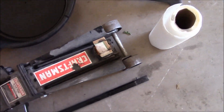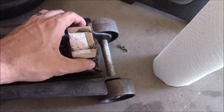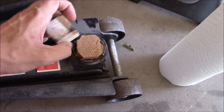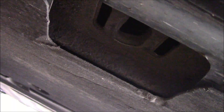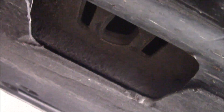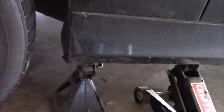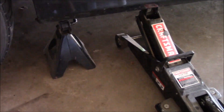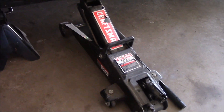The other thing you're going to need — I have a real one on order but I rigged this one up — is a jack pad adapter. I cut a little piece of wood to fit inside and got a small block on top. The jack point on this car is recessed, so your jack may not fit and could mangle something. I've got the car jacked up; I'm leaving the jack holding the weight and put this under here for safety so the car won't fall on me if something were to happen to the jack.